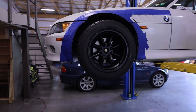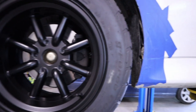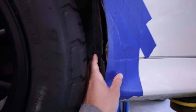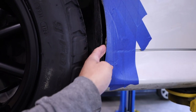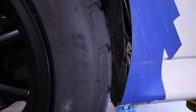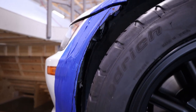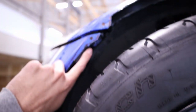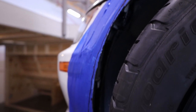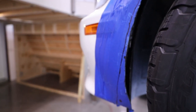Quick update: as you saw, I got the front wheels back on. I can get almost to full lock — I think I'm still barely hitting in here. So next time I have the wheels off, I will cut out just a little bit of metal in there and cut out a little bit more of the liner as well. And in the front, the only spot I really saw was just up under here, and then a little bit more plastic needs to come off down here, which is just like bumper support, so that's fine.